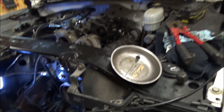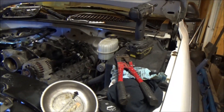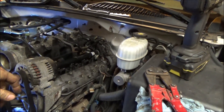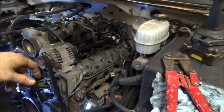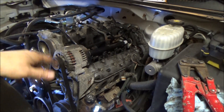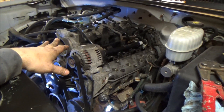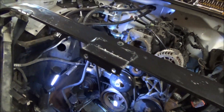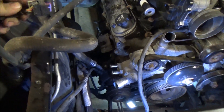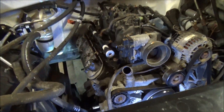Welcome to part five: how to set up your intake. This is an overlapping part because we show you how to finish connecting the fuel system after doing the twin pumps in the back, how to install the injectors, get your MAP sensor options taken care of, and in the case of the truck intake, also installing an IAT or intake air temperature sensor. These trucks were mass airflow originally, so the MAF meter would have had one of these wires for the IAT sensor.